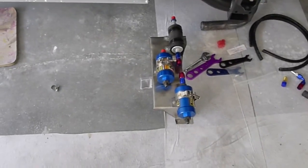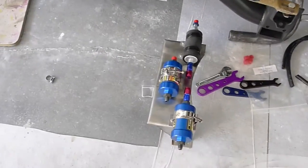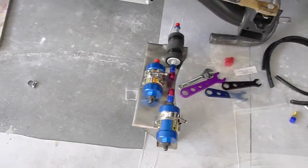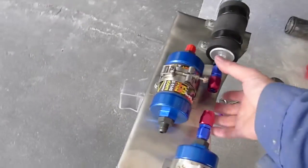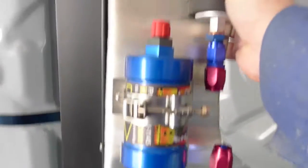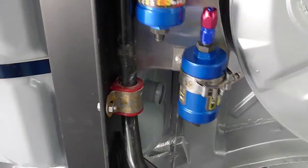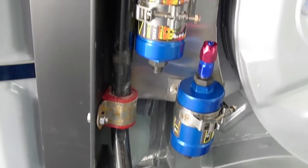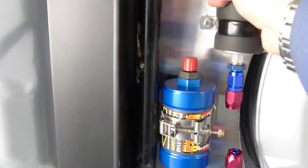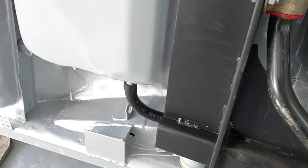This is my new stainless bracket for the fuel filters and fuel pump. I'll just pick it up and show you what happens here. This gets put — it tucks in right in here, so basically it's behind the axle sway bar assembly. What's nice about this setup is that the fuel pump and filters are at the level of the bottom of the tank, the inlet outlet.